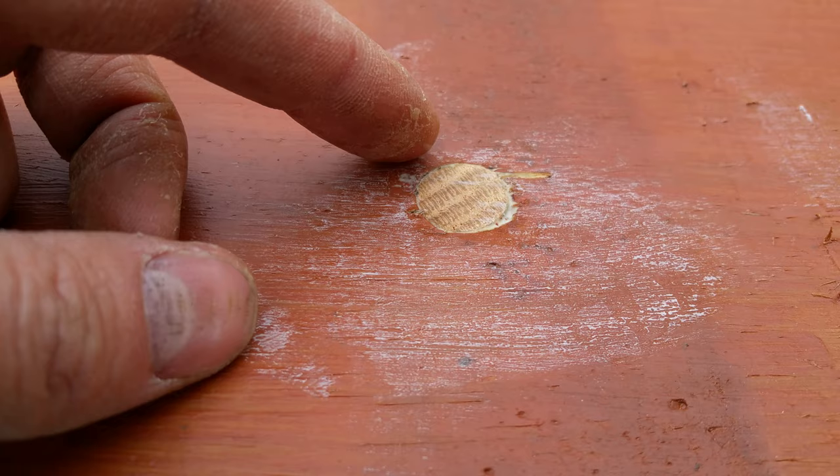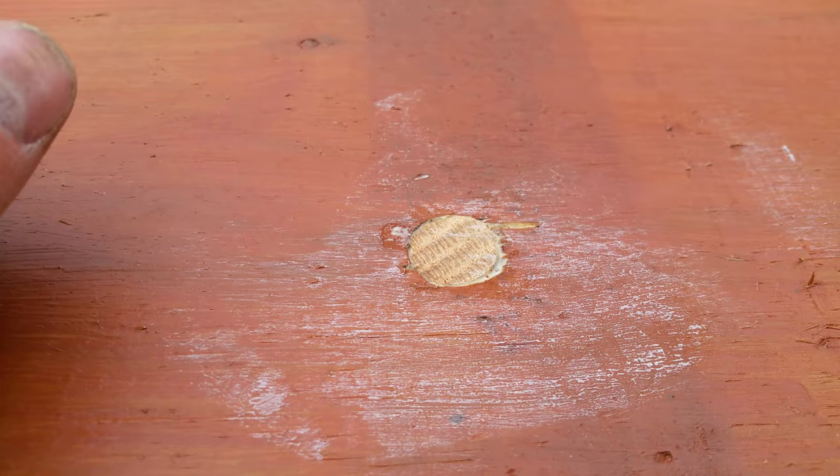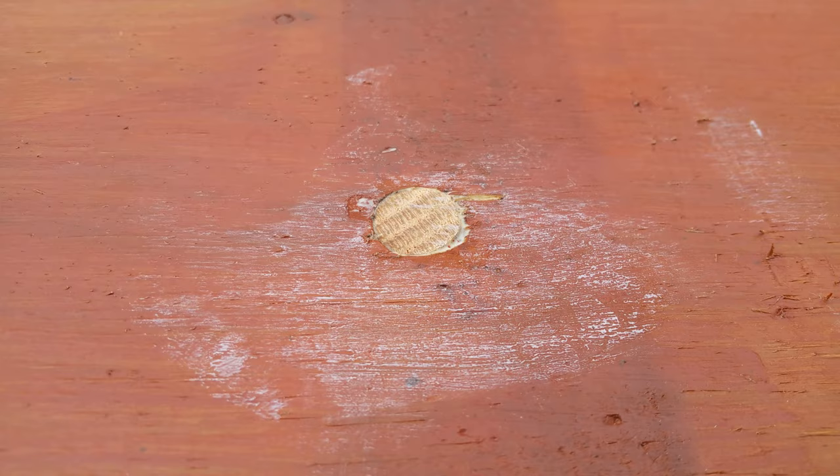Here's an example of the plugged hole. I drilled it out to a 5/8, put a 5/8 dowel in there and glued it in. Something I didn't think about till after I started pounding a couple of these in is aligning the wood grain of the dowel with the grain of the board. That's just aesthetics. Something I'll do on the other ones, but this is how they're all going to get plugged,